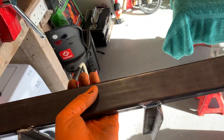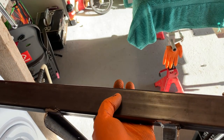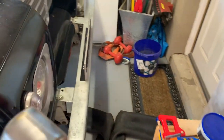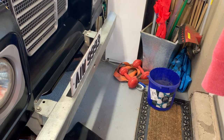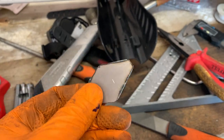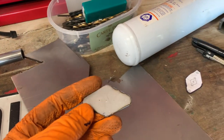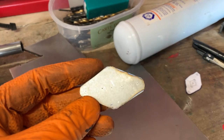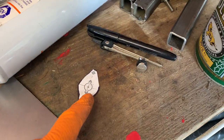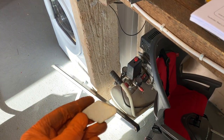The last bit is to put the little starter handle escutcheon on - it just sits there slightly off-centre, lining up with where the engine starter would really be. Here we have the starter handle escutcheon just cut out from the template using the angle grinder, which is significantly faster than using the hacksaw. I've marked one, two, three, four, five little holes - I'm going to drill them through and make sure those holes are there, then weld this onto the bumper. The inside of this will be left dark grey and the rest will be painted silver to give the illusion of the hole going all the way through to the starter dog of the engine. So that's the bumper ready to get painted, which is really pretty cool.